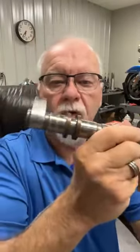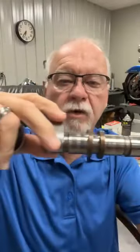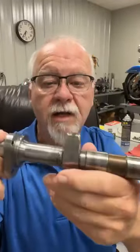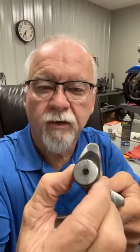And this is so old, y'all. This is before we had bearings on the end. We had bearings here, and this lobe was just trying to break off all the time. It's unsupported over here. So the buckets would last for 4 to 8 runs. The cam would last for about 20 runs. So we would send it back to Kip, and he would reduce the base circle from 1 inch down to about 980, and then he would get me some more buckets, and we'd race again.